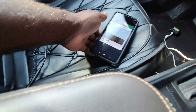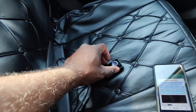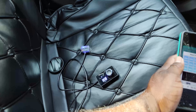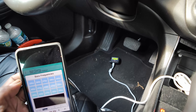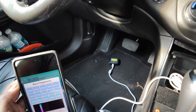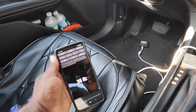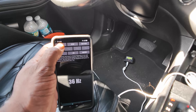Let's increase this to 47 and run that again at 36 hertz — that's a 135.1. Put this on 48 and run it again at 36 hertz — 136.7. We're going to do it anyway: put it on 49 and see if it bottoms out. It is building up some pressure back there against the trunk. 36 hertz — couldn't really tell, still a 136.7. 37 hertz — 136.9. 38 hertz — it bottomed out on that one. I'm scared to put it up to 50, so I'm not going to do that. I'm going to use the other app to creep into 36 hertz.